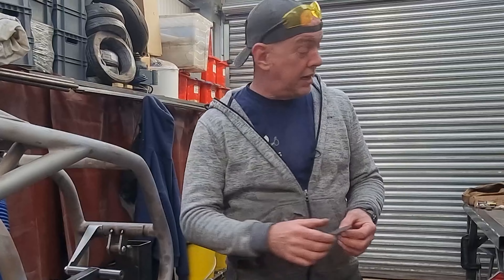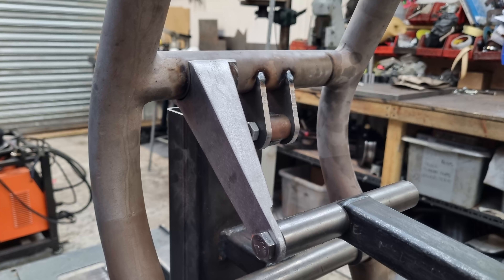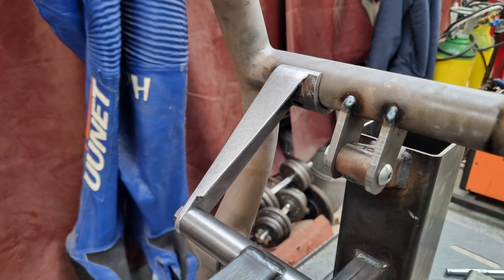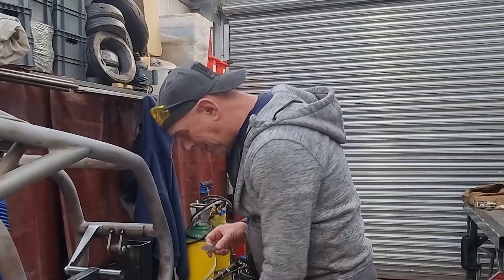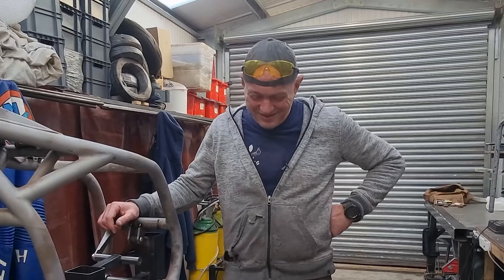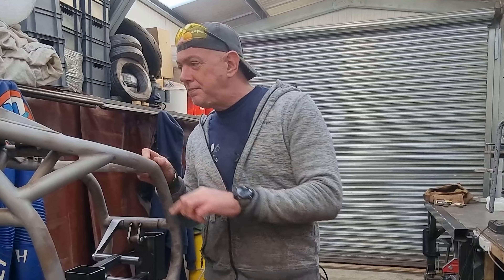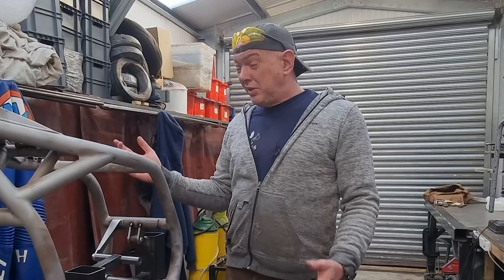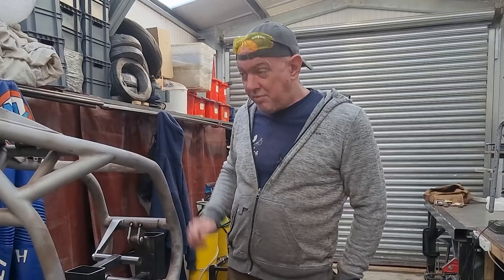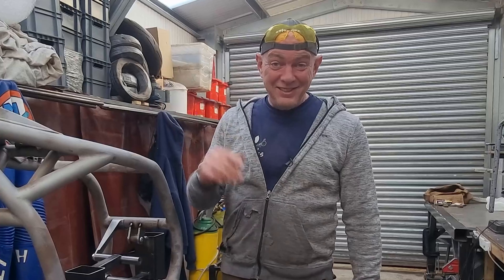Right, that's it. I'm done, I'm calling it a day. This cold is getting the better of me. That's one that I haven't dressed up yet — it was all well prepped, I've just poured the weld in, left plenty to dress back, and that's what it comes up like. I also started doing my lower link mount — but you know my template and everything else? It's too short. It's like 5mm too short, so I've cocked it up. I'm just not thinking straight, my brain is smush. I've sneezed in my welding lid — that's not pleasant. But anyway, everything is going to get primed. Because even though this has been shot blasted, it's already started to flash rust. So as I do stuff, I'm just going to prime it and stick it on the bike — it will just stop anything deteriorating, and it will probably look quite nice as well. I do hope you're well and staying safe — we will see you on the next one.